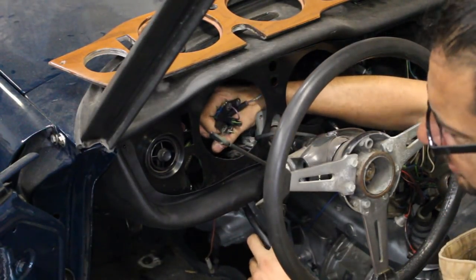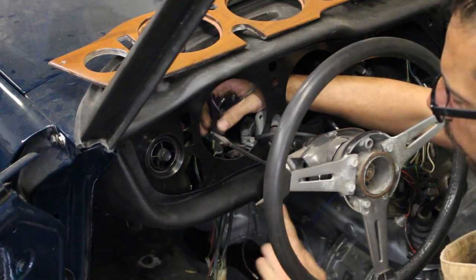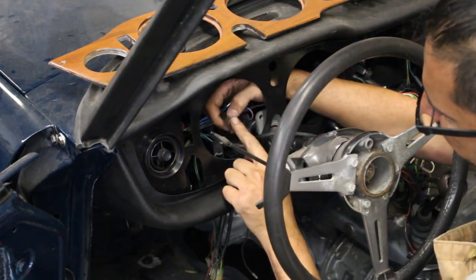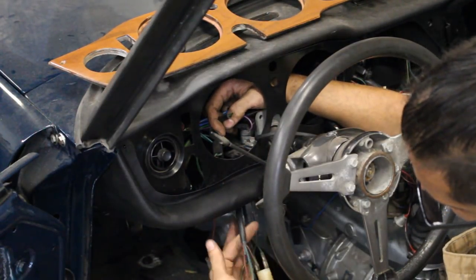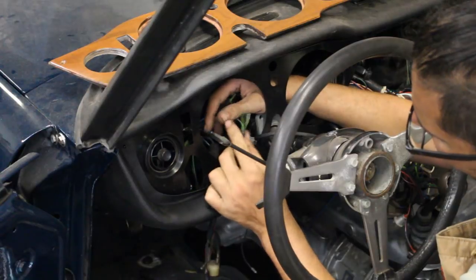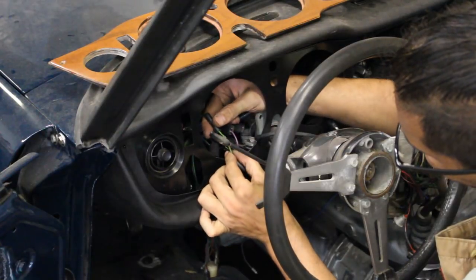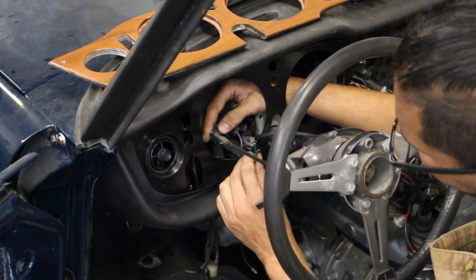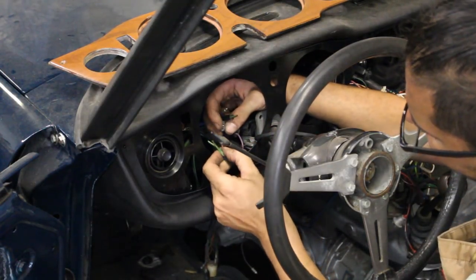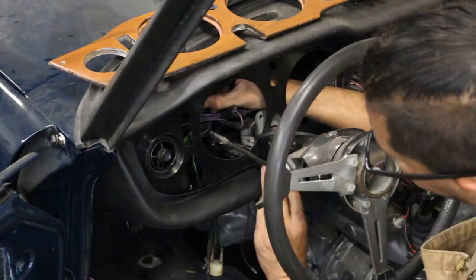As you know I replaced the old harness with a new one, but wherever I had something put in the connectors in the old harness I moved everything to this harness. Now I can see that this green and brown was cut off here. You see here I have green and brown — that's actually what has been cut from here. And the same for here: I have a green with red, and I have a green with white. So three of the wires are sorted already.